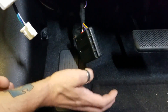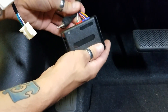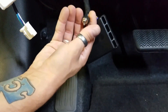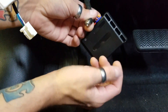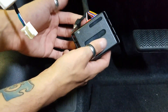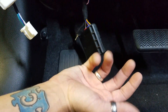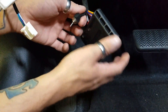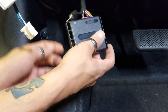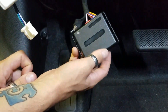I got down there and got the 30-pin harness plugged in. Here's our module completely plugged in. This is our safety disable switch — it's an on/off switch. Yours is going to have an on and off label like our auto headlight switch. It's a completely disabled switch: for any reason you want to disable the remote start, switch this to off and it basically disables the whole thing. It won't activate from the remote — it acts like it's never there. When you're ready to turn it back on, flip it on and you're good to go.